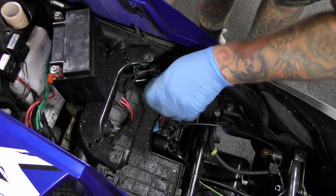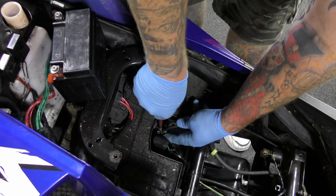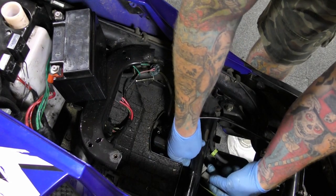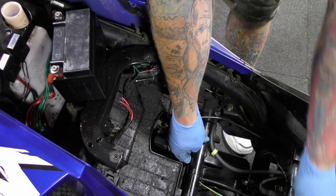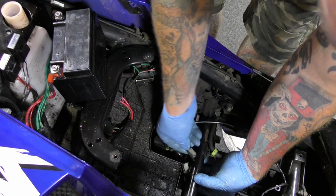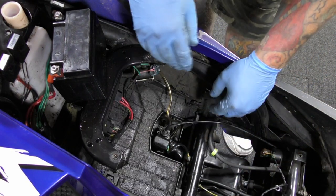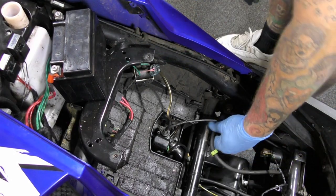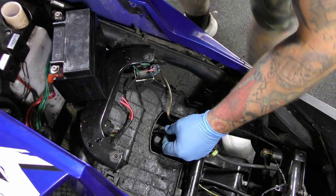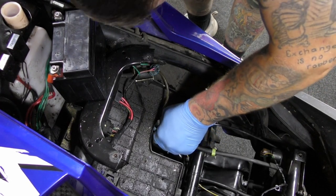It's only good now — I've been taking this apart about 15 times but it's got a new gasket on it. Make sure it's really tight, you don't want any fuel coming out. Don't forget to do your choke. This is a Mark 3 so make sure this is on the underside — don't make the mistake people do putting it on top, because the seat will sit on it and damage it. The last part to connect is the fuel, which has a nice little clip on it — that should be nice and tight.